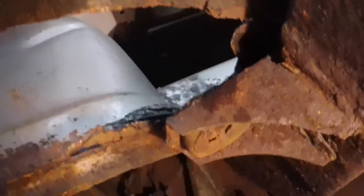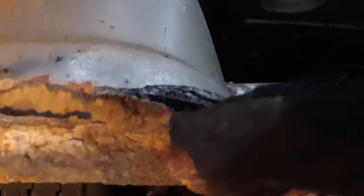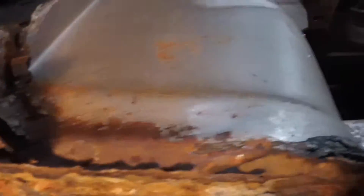This inner wheel well is completely solid. It's just this dirt got up in that brace and just rotted out the body and the brace. Everything else is solid. The rocker panel on the passenger side doesn't look like it was ever rust-proofed, so that's why that rusted out. I just kind of wanted to show a little bit of what I'm doing on the car before I start putting the metal in and welding it up. That paint — that's why I was wondering what's wrong with the quarter panel. Why did they brush paint this? I can't see a reason why other than the paint got scratched up or something, because there's zero damage to the quarter panel — no rust, no dents.